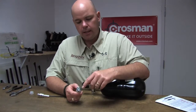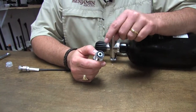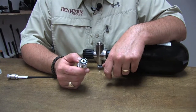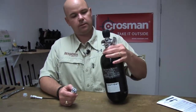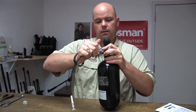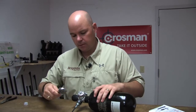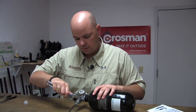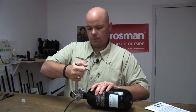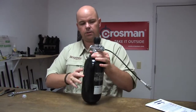Your fill hose has a little rubber gasket. It's fitted into a nice little seat — it's not glued in there, so it may fall out. If it does, pick it up and place it back on there. You don't need to lube it or anything; it just sits right in that seat. Put the hose right into the fitting. Once you get it nice and tight, have a crescent wrench available so you can cinch it down just a little bit more — you don't need to really crank on it, just until you feel it's nice and snug. This is your completed assembly.